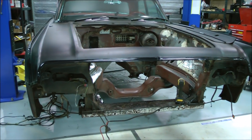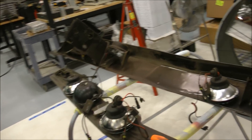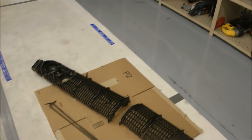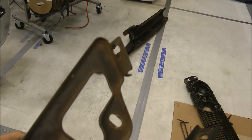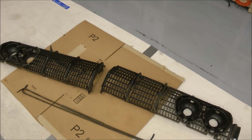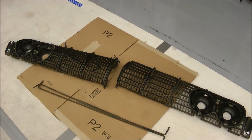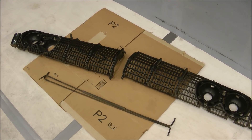The front end teardown is pretty much completed. We've removed the whole front bumper, splash shield, headlights, and headlight buckets. There's the two-piece grille that came off, torsion bars, and some of the hinge parts are not in the best shape. All of this is going to get media blasted, cleaned, primed, and readied for paint. By the way, to remove the grille you actually have to remove both vacuum tanks from inside the fender and the fender shields just to get to one single little bolt on each side. Got to love these old classic cars.